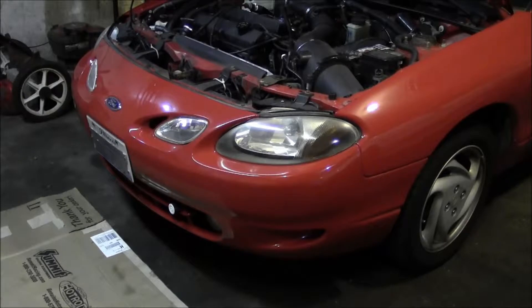I figured I'd get into doing some HID diagnosis, and also I'm pretty much gonna do what I did to the Lincoln. This vehicle is kind of the same way — when you're driving at night with your headlights on and you hit the high beams, you lose your fog lights. So I want to eliminate that, basically put the fog lights on their own separate circuit. I'll probably wire it up so it's key-on hot, so I could turn them on without any lights being on, and that way if I'm running my low beams and turn on the high beams I won't lose the fog lights.